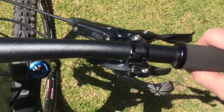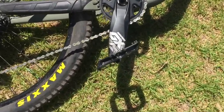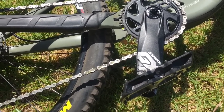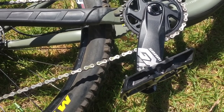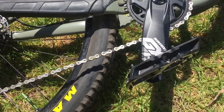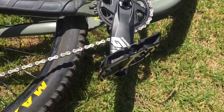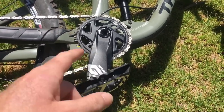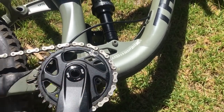The GX has a more crisp feeling — it just feels a bit more robust. For the cranks, I'm running the SRAM GX 165mm cranks. The NX cranks felt fine, they didn't feel flexy at all. I'm assuming they're just heavier — that's probably the only real difference. So if you want short cranks but the GX DUB cranks are expensive at around $220-$230, don't be scared to go short NX cranks — they'll still do a good job, and you still get the same X-Sync direct mount front cogs.